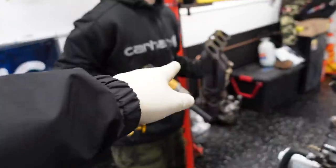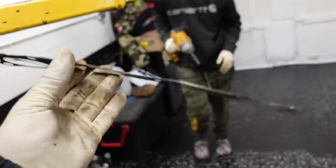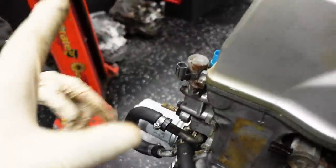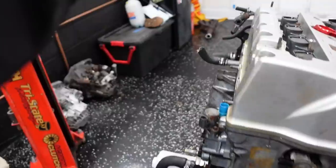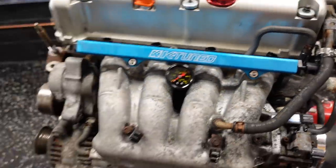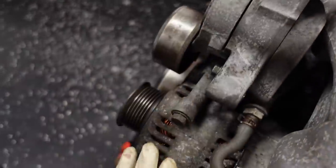So that's garbage. You can throw it out over there. These gaskets, OEM, barely go bad. So we'll keep that one around here. What I suggest is, no, you're going to keep that solenoid on there. What I suggest is we take off the back pieces and we take off the front, so we can start working. You can't take off this manifold without taking this stuff off first.